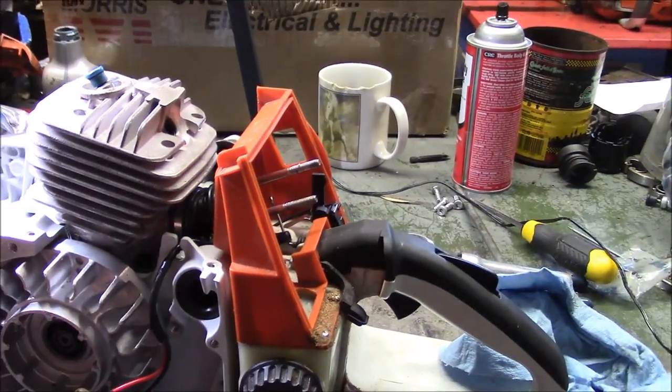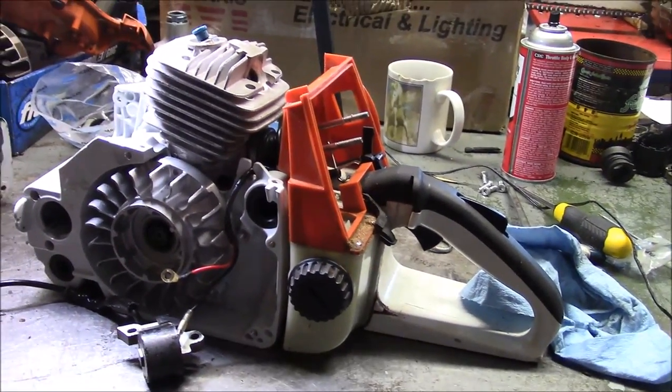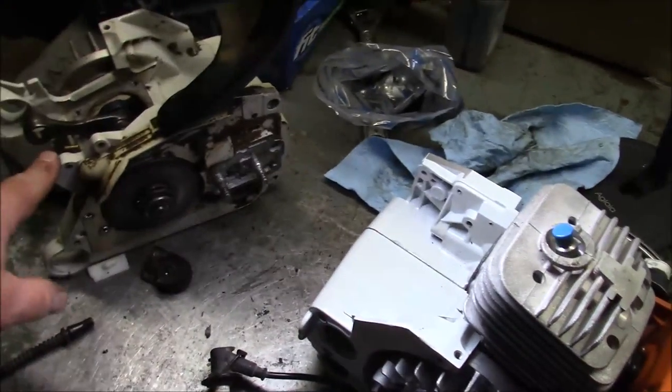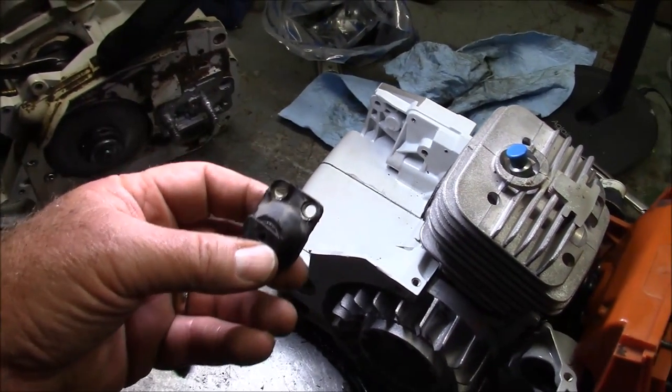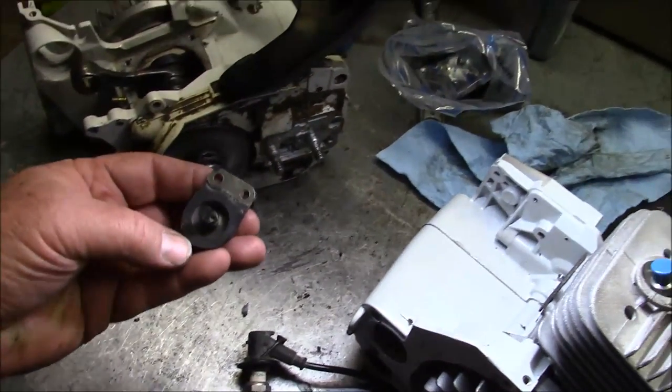This is the ongoing series — I keep you all updated. I've got a bunch of these out now and this is getting to be statistically predictable. Handles bend, clutches fail — things like that. This is the first anti-vibe mount I'm putting on film; this is the first one of these to fail. But I think what happened is because when that handle got bent, it got yanked hard and just torn right out because of that event.